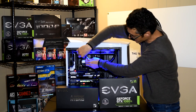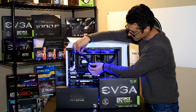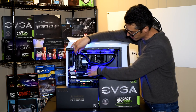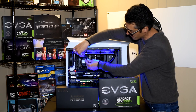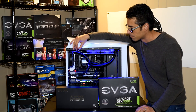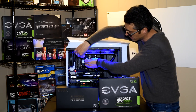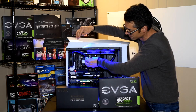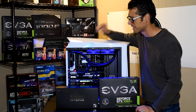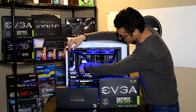The last thing I didn't realize until I went to hook it up was that the fan cable has a three-pin connector. I thought the fan might plug into the motherboard, but in fact it doesn't — it plugs right into the video card. I don't know why EVGA doesn't just connect this from the factory, because it runs right along the hose line. One thing I'll mention about this fan: it has a very short power lead, and it's really quite loud at idle — it starts at about 1150 RPM as controlled by the video card. My preference would be to hook this up to a motherboard fan header for more control and to get the RPM lower at idle.